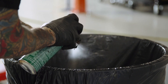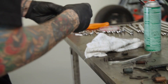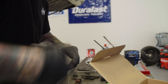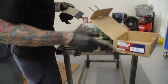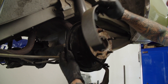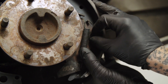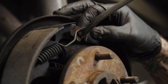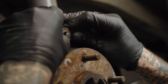All this stuff is in really good shape, just a bunch of brake dust. We're going to go ahead and start reassembling. Let me go ahead and grease all this up real quick. Now I'll screw this all the way in and then adjust it once everything's installed. That's what I was talking about — a primary and a secondary. The primary is the one with less lining. Make sure you get everything seated — just don't pinch your finger. There you go, get this all where it needs to be.